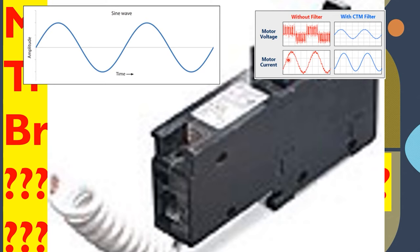So the three causes are: a simple circuit overload, aging components that are wearing down and causing shorts, or an arc fault breaker detecting an abnormal sine wave from the motor. Sometimes it trips right when the vacuum starts, sometimes after it's been running for a few minutes. I hope this video helped you out today!